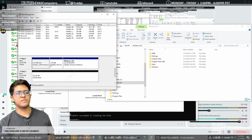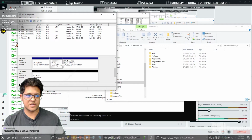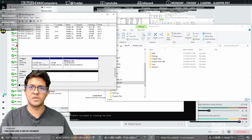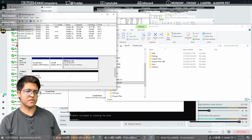So I think our best bet is to delete the first 2 partitions and assume that it's just boot data, because this is the EFI file system right here. This is the one that it's probably booting from, and the OEM partition probably just has whatever utilities they use to scan the operating system. So if we delete these 2 and then clone the D partition, actually, you know what? We can delete the first partition, leave the second partition, and then clone the entire drive like that. That'll work.